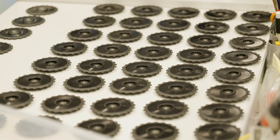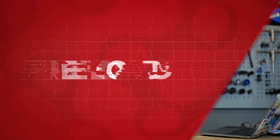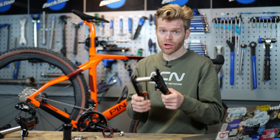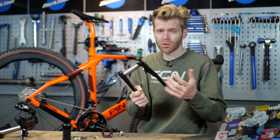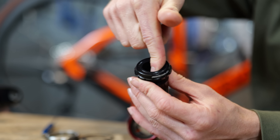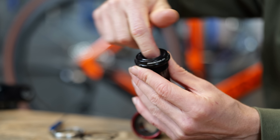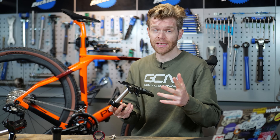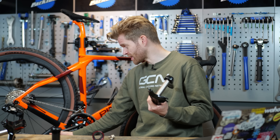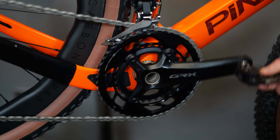As for the quickest way to destroy bearings, I spoke to some engineers and experts from CeramicSpeed in Denmark who gave me the following information. The first thing is incorrect preload — both too much and too little is bad. Too little will cause play or knocking, poor alignment of the bearings, and increased wear from impact loading. Too much preload and you will generate more friction, which creates more heat. You'll have excessive bearing wear and your bearings will just feel rougher, and your chainset just won't spin as nicely.